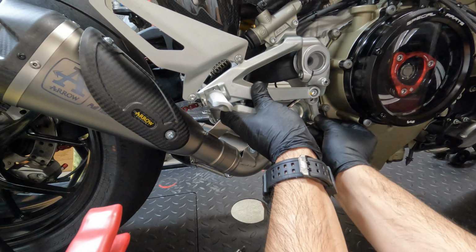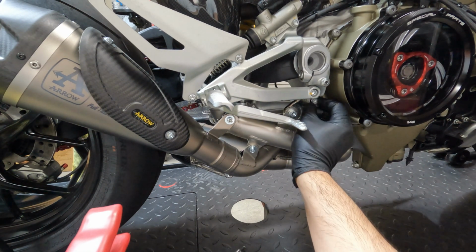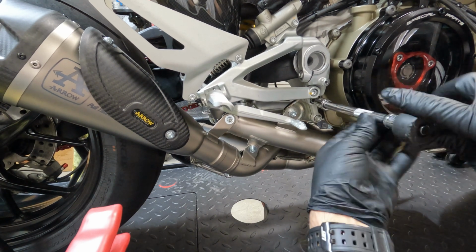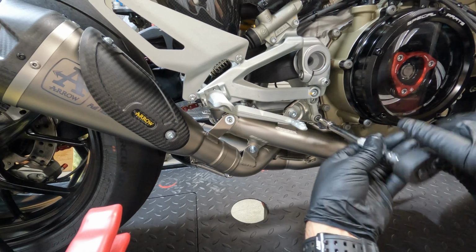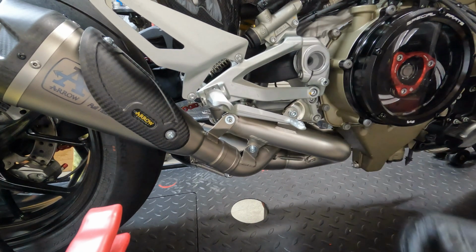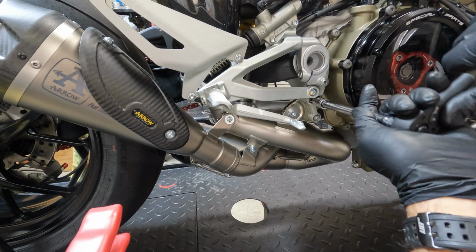All right, so now it's just a matter of putting these bolts back in. So these lower bolts are gonna get my alignment back to where the rear set was. I've got torque settings that I'll post below in the description. For right now, I'm gonna snug these up evenly. That should drive that onto my swing arm.